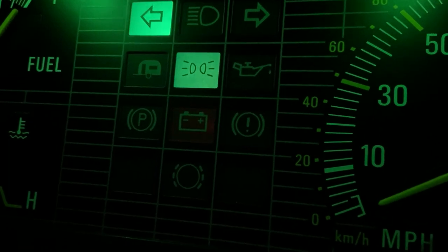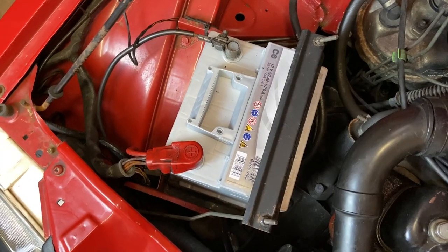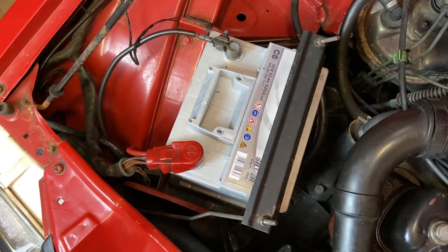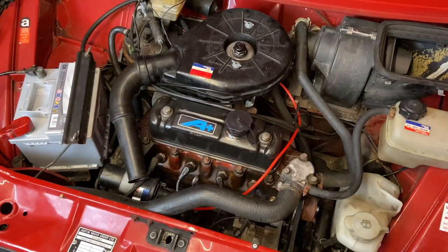Then we got to see the charge light rear its head. It's more obvious to see with the pulsing indicator, hence why that's on. Once I'd scurried home with no wipers, a misted screen, and on the side lights, I hooked up my multimeter. It gave the reading I've already described, and I decided the alternator was shagged.